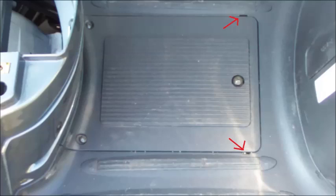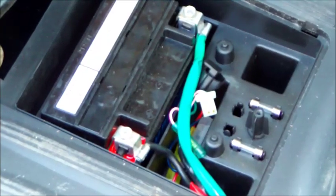There are two notches that we're going to use to pry it up. Once we do that, kind of pull it towards the front of the bike as we're lifting out. And voila, there's our battery.